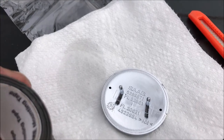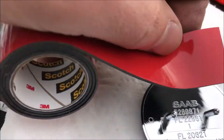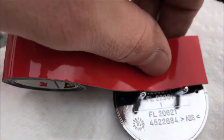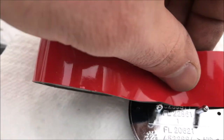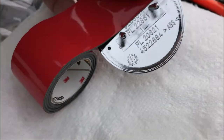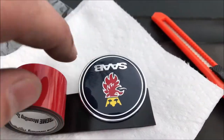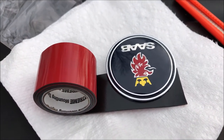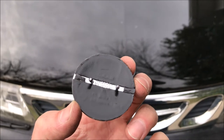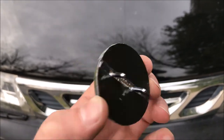I'll show you how to add adhesive. We'll take some two-sided tape — this is 3M extreme mounting tape. Lay it along the back and press it into place, do the same at the top and bottom, cut it to rough size, then flip it over and trim the excess with a sharp knife.